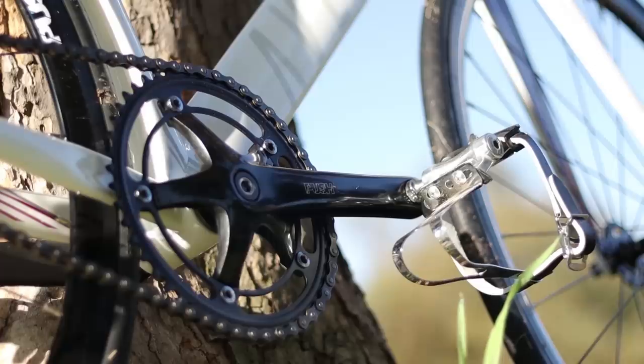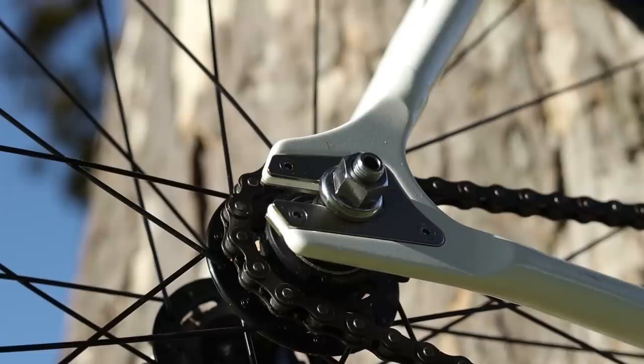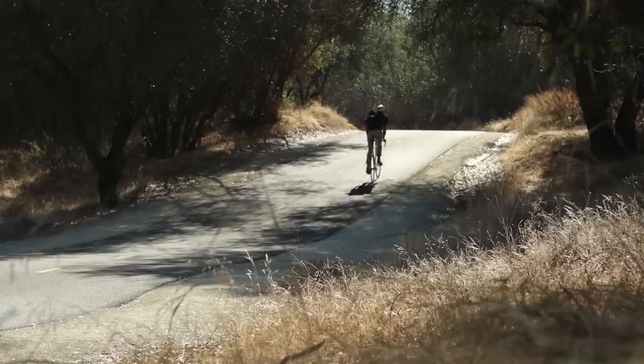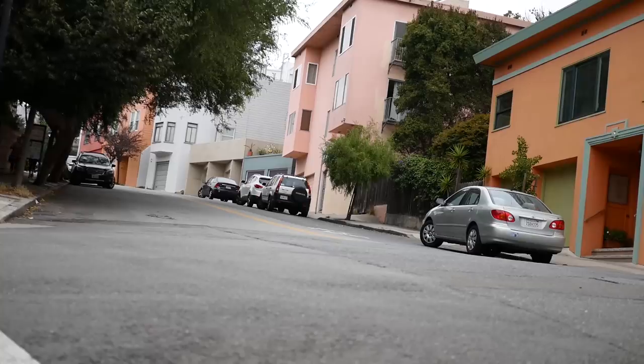What I can say does make the bike faster is its gear ratio. It's 48-15 and that's why my thighs hurt. This gear ratio doesn't seem like the most practical for street riding, which most people who buy this bike are going to be doing. Even here in Sacramento where it's almost entirely flat, I felt that 48-15 was just too big. The climbing I did was just some rolling hills along the trail on the river, and even then it felt like a slog getting the bike up those hills. I can't really imagine how you would deal with the stock ratio if you actually have real hills and mountains where you live.